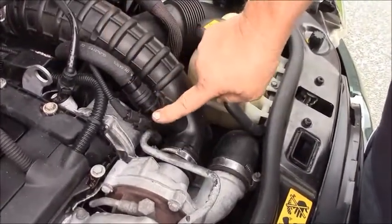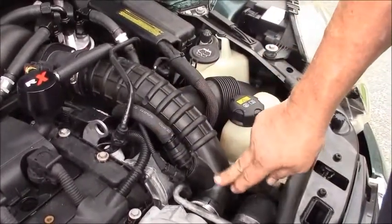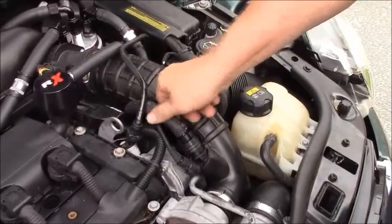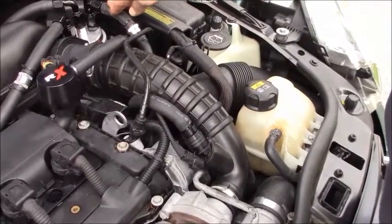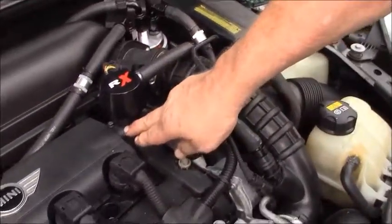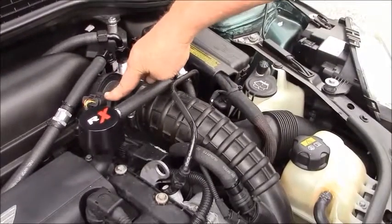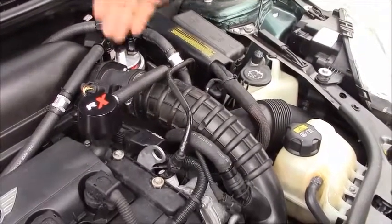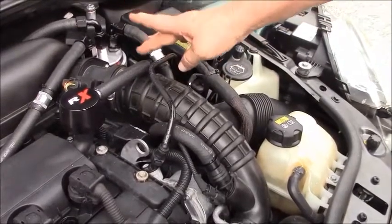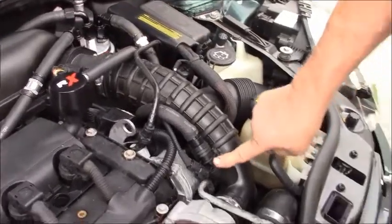Now there's a little flow sensor on here, so this can't be deleted. This is an ideal situation. The Venturi effect of the air going in creates quite a bit of suction and gives us evacuation when we're in boost. We're retaining the clean side, but we're moving it up here so we're still downstream of the mass airflow sensor. So all the air is metered as it's coming in, and there will be far less suction at this point than there will be down here.